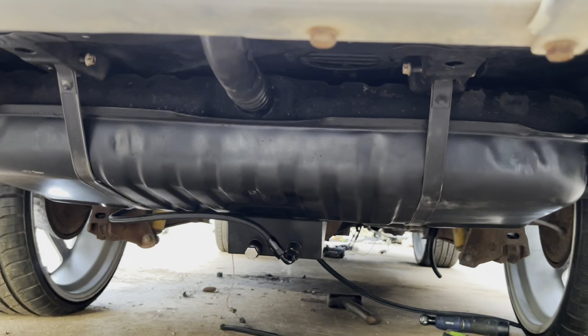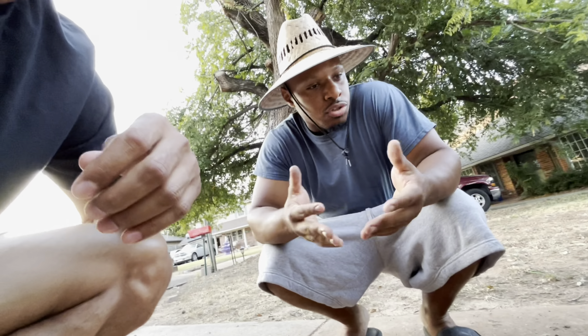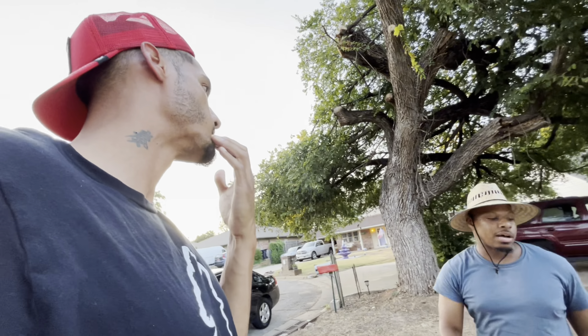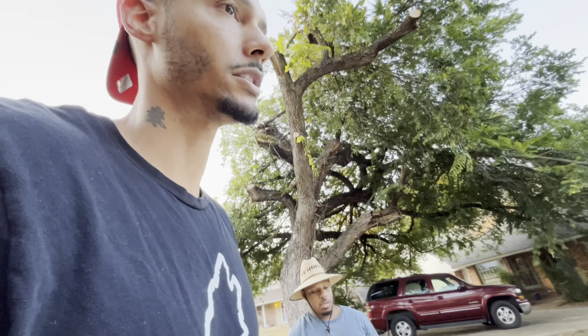He's got the pro mod tank — when your car's got a sump, y'all know what that means. Get you a sump — that's going to be like $30 to $40 bucks. I welded my tank on there. If you don't trust yourself to do it, take somebody to do it. All I did was an inline sump. Yeah, because old boy was asking about the sump. He did his himself — I took mine to Able Racing. Because they don't even make tanks for these box Chevys, so you have to take it to a shop.